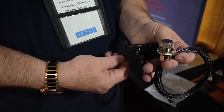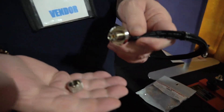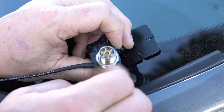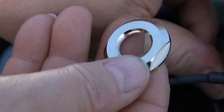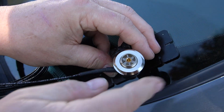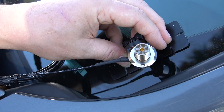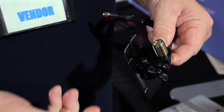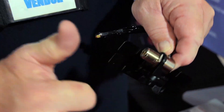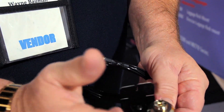So now you've installed and mounted it on the vehicle. What's the next thing? You'll take the coax assembly and take the weather cap off. This has a double nut — a decorative piece that covers your main nut. In the old days you used it for adjusting antenna height, and a lot of guys will put it underneath. But now you'll take it off, get it inside, then put your nut back on to tighten it up. When you get this all the way at the bottom and tighten it, the decorative piece covers that nut and gives a little more surface area for the antenna.